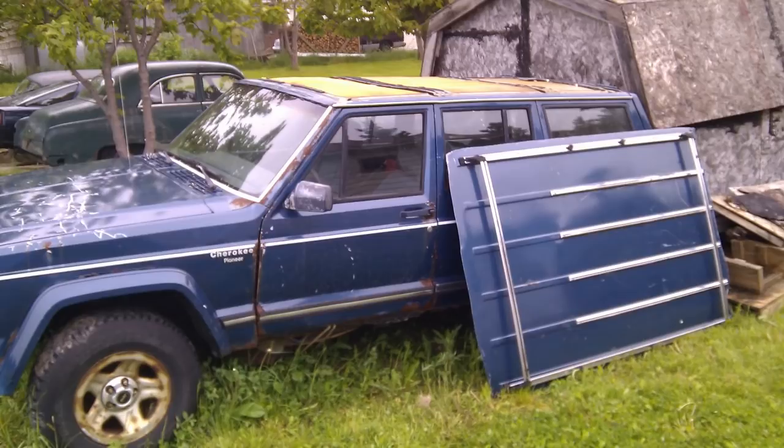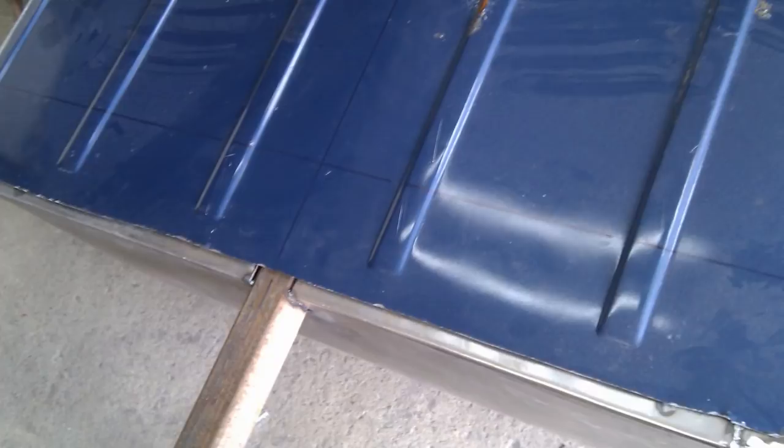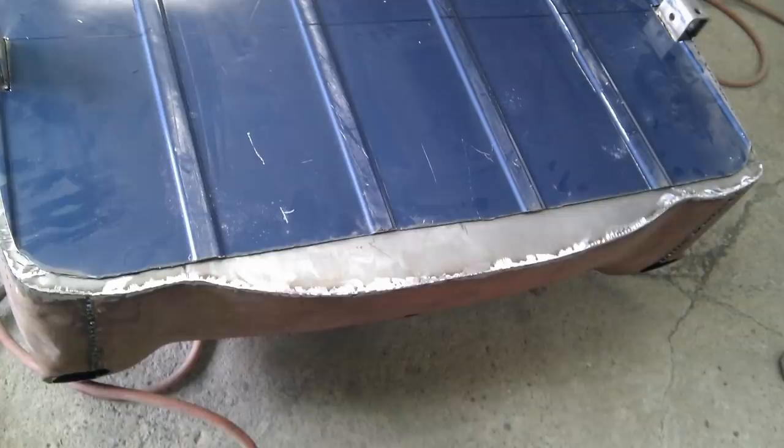Sometimes you find a floor pan in the strangest of places. I was getting ready to get rid of my old plow truck and noticed the roof on it, so I cut the roof off and it worked out perfectly — I used that for the bottom of the trailer. Up towards the front I put the beads faded out so I could seal the front of the trailer up nice. On the back side I let the beads run off and left them open, so if any water did get in the trailer, it would run out through the back.